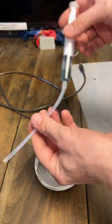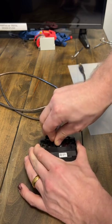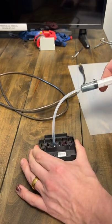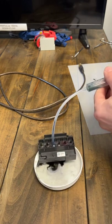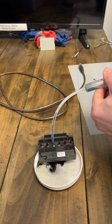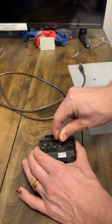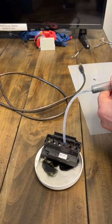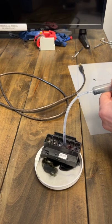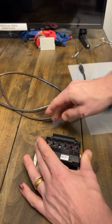Take a syringe with the little hose on it — say your two center ones are the most troublesome — and pull the ink out of there. You can kind of see it rising out; that one's pretty clogged. It should flow fairly quickly, but that's barely flowing at all. The other problem cartridge you can see just barely starting to come up, so that's pretty clogged too. You can see the black ink is just pouring out of there.